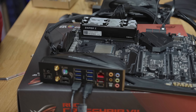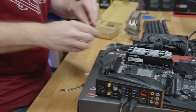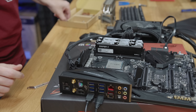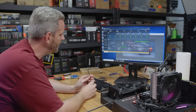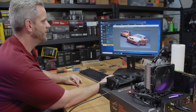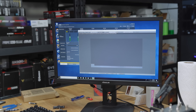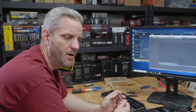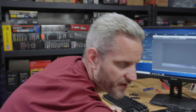It also doesn't use the stupid plastic retaining brackets — it uses its own mounting system so you get the best torque and mounting possible. Last time we hit about 95 or 96°C before it crashed. So the test is about to finish — 90.25°C. The impressive thing here is that this Noctua cooler was only about 5°C cooler than the Prism.